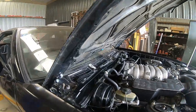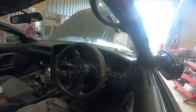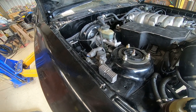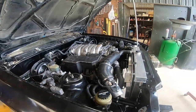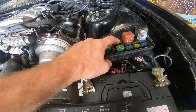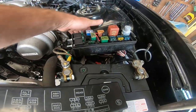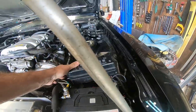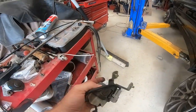So we've got a shortlist. I've also got the wiring underneath the dash to do with the old turbo timer wires and there's an old alarm in there — it's pretty ugly. And a speedo and a tacho. I am running the factory fuel pump system so it bypasses with a dropping resistor, and then it's got another relay to give it full voltage once you're up in the revs — that's why it works really well with the factory Lexus. The only extra fuse I've added is this one for the drive-by-wire. And I've added these two relays for the fans, and taken all those air conditioning relays away.